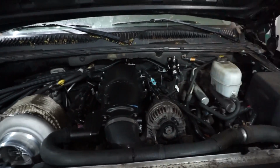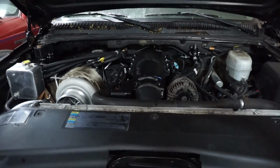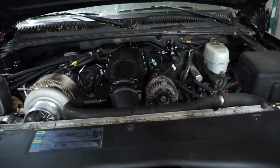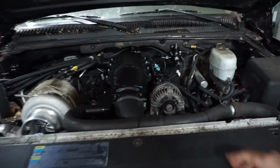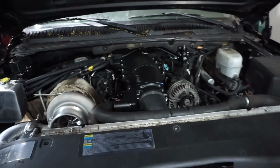So also I did end up moving all that other stuff, the boost controller, map sensor, and added a vacuum block. I did all that stuff because I was troubleshooting this issue. So in the end, it's better than it was before, and I'm pretty happy with the setup now. It has the Bosch 210 injectors, and everything's out from underneath the intake. I do like how everything looks.